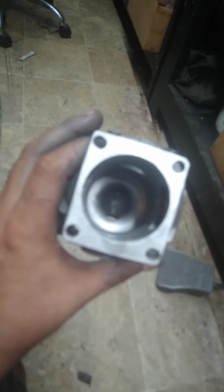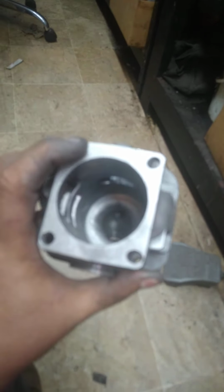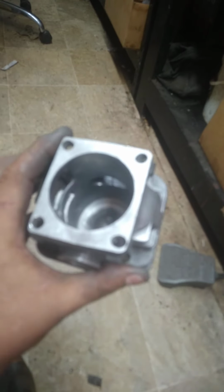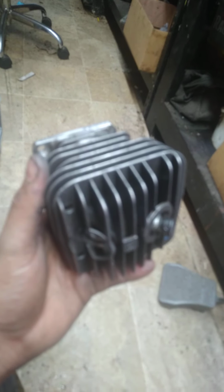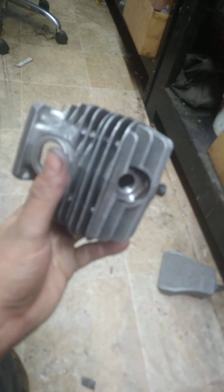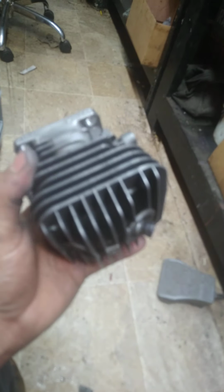On these, if you're putting a 460 cylinder on an 044, you have to elongate these holes toward the inside of the cylinder, or it's just not going to fit. Whoever did this one didn't do that and just kind of forced the bolts down in. I don't even know how they got them to go in, but we had to chase 3 of the holes and had to repair the 4th hole, but we've got it all fixed. It's all good, no problems, but thought I'd share the port work on it, talk port texture a little bit.